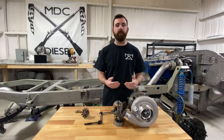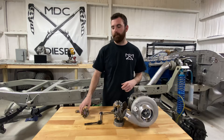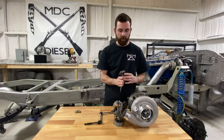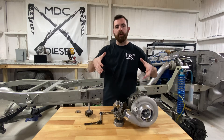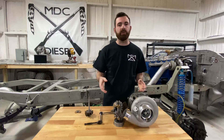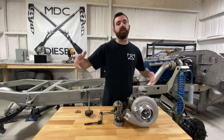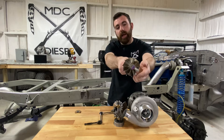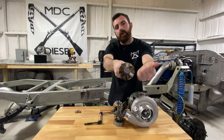To understand what drives the turbocharger shaft and speeds it up and slows it down, we need to understand the forces applied to the shaft. A wheel is essentially a device to leverage a shaft — think of a steering wheel on a big school bus being larger diameter than in a small car because you need extra leverage to turn that steering shaft. On a turbocharger, the fins can be seen as levers — just a bunch of little levers that turn a shaft as it goes around.